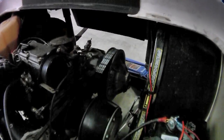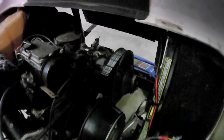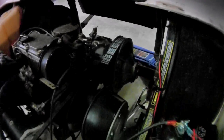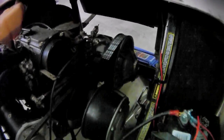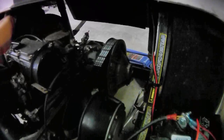As you can see, the drive clutch engages right when we start the motor, and that's terrible. It's designed to do that for safety, but we're going to convert the ignition harness so the motor starts and idles, constantly powering the generator, the radio, and the headlights. The drive clutch is bad right now — basically worthless. And the back clutch opens too soon for our purposes. For rock crawling, you roll up to the rock, stop, survey the area, then get on the gas and crawl up it. Speed kills when you're crawling, so we need torque springs to lower the speed.